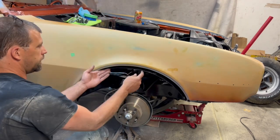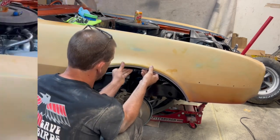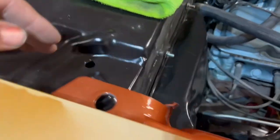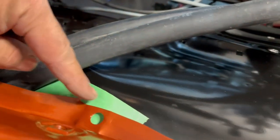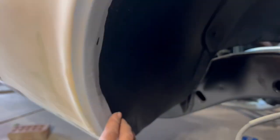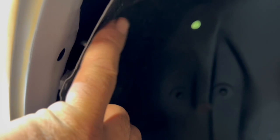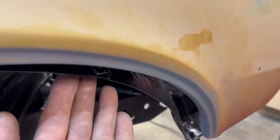Now we're kind of sort of roughed into place — it's just kind of resting in here. I'm sitting above the wheel well, as you can see there. So what I need to do now is get the wheel well tucked up inside the fender. You can see it's kind of resting into place — got it tucked over the heater box like we need to do. This is what the tape is for — it keeps this from scratching the heck out of our nicely finished inner fender well. Now the part we're going to be fighting though: this is the inner fender well — it needs to tuck up inside the fender. Back here is fine, but I need to start getting that fender to go back up inside the inner fender, inside the actual outer fender here. So I'll work on getting that kind of pushed into place while pushing the fender back just a little bit, and hope we get it all hooked.